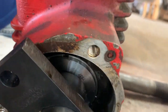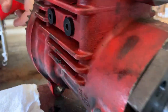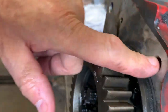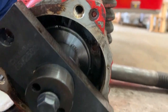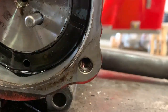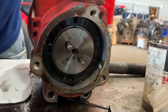Here in the back we've got our tool installed, and there's the bolt. Notice there's a little slop in that bolt hole in the bottom right — it doesn't have to be perfect, because once you get it on there and go to put the pump in, you really have to clock it to miss your gear. I've got my finger in the hole where your alignment mark goes, and you'd be ready to install. Remember the pump head must be off if the pump is fully assembled — you'd need the tool to hold that gear in the right spot. And remember, the crank has to be pinned on the damper — line that 'insert pin' line up exactly with your line on the front cover for your overhead set.